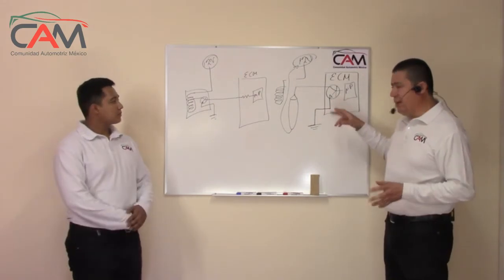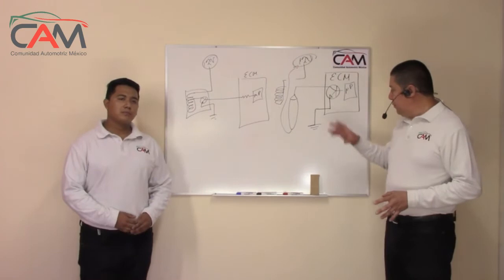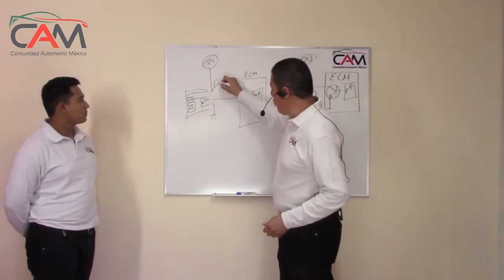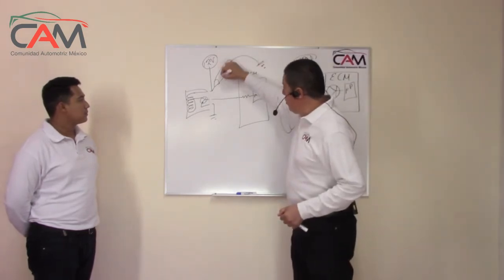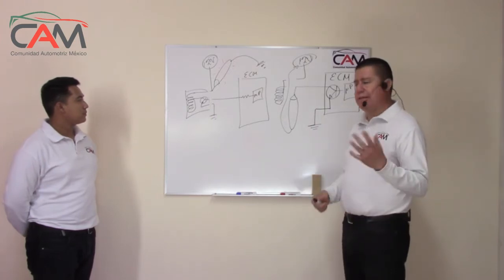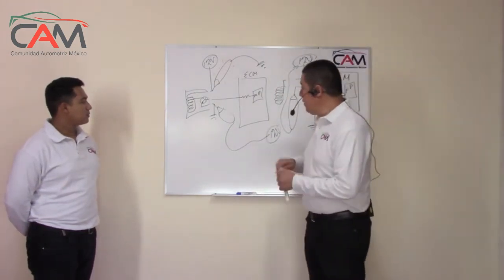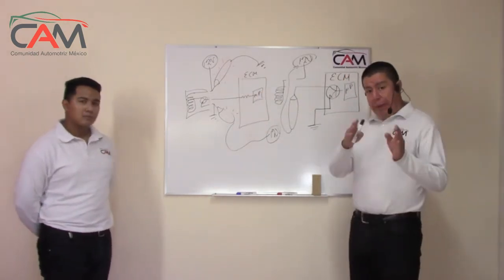Some manufacturers use the same driver to activate not one but two or even four coils, so be careful. For indirect system testing, similarly, I will verify current arrival with a test lamp connected to ground. With the switch in ignition, the lamp must light. If not, there is no good 12-volt supply — check wiring, fuses, and relays. A similar test is done on the negative side, connecting the lamp to 12 volts; it should light intensely. These two tests use a conventional lamp.